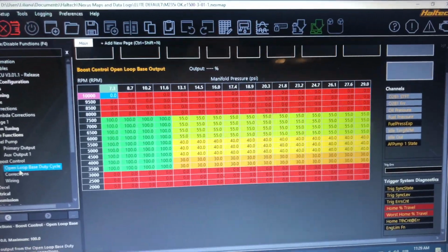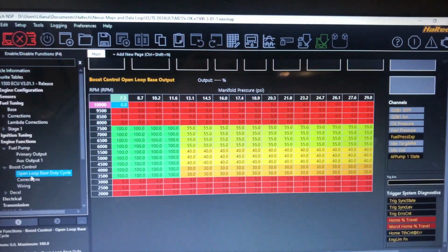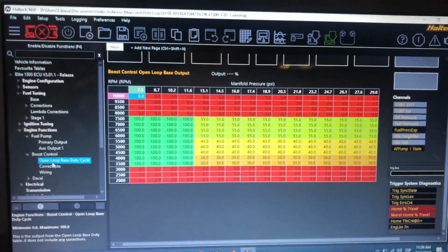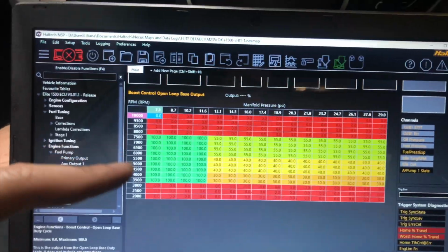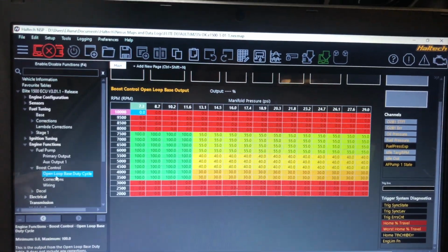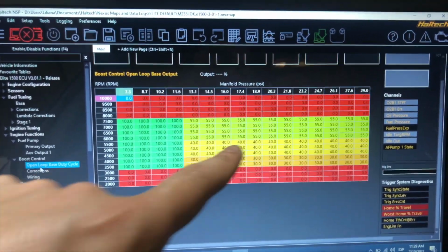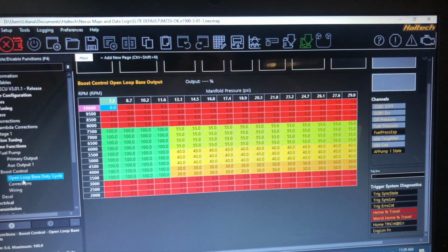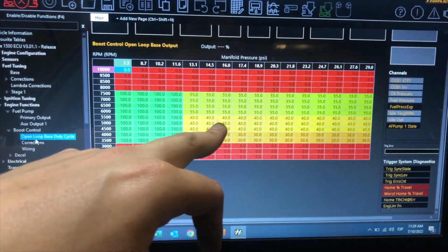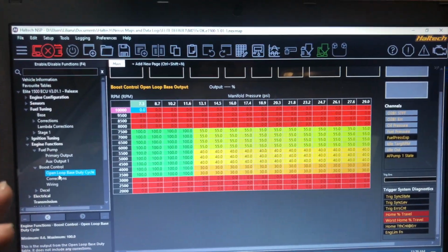So let's remember, power is torque times engine speed, or rotational speed, if you want to talk in general terms. So if you want to make power, you can make power in the top end. That's why my duty cycle is higher on the top end, and keep the torque down. So that's why I like to keep this. Actually keeps a flat torque curve, so you can actually feel the power coming on all the time.